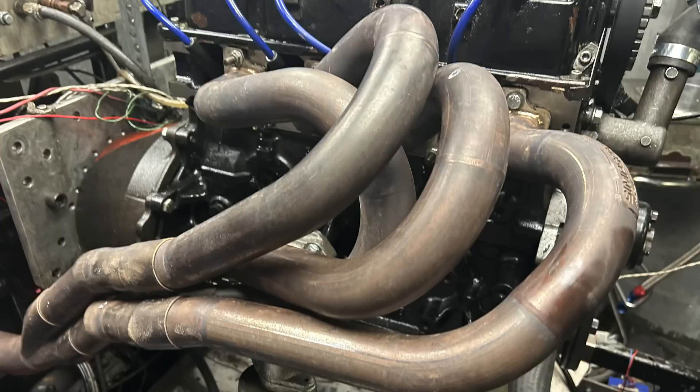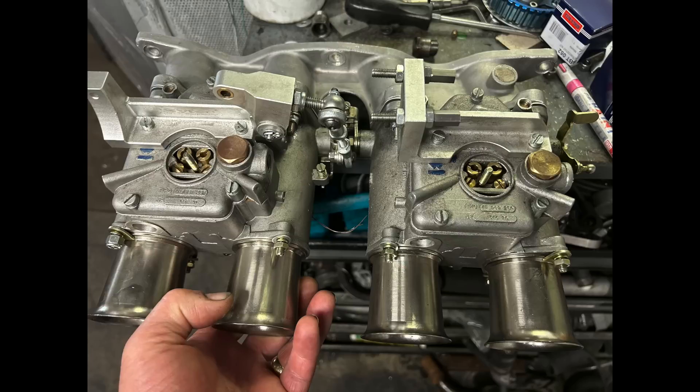We decided to throw something at it and I put a Simpson manifold on it - beautiful manifold, lovely looking. This is a Simpson one with a 2¼ inch exit. No way did I think that the Simpson manifold on its own would have pushed us past 200 brake horsepower, so at the same time I did a carburettor swap. Off came the 45s and on went a pair of 48s, which at the time had 42mm chokes in them - plenty of airflow. Same GTS4 cam, Bestec distributor, 11.3 to 1 compression, Burton race head, but this time the 48 Webers and the Simpson.